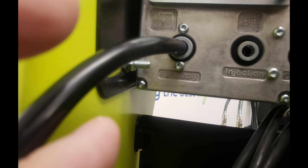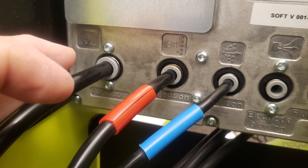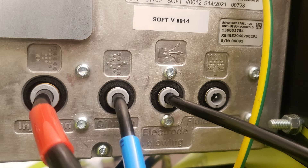The 10mm black air line which is supplied will come from the outlet port of the air filter and connect to the back of the InnoBox controller labeled air supply. Connect the black 8mm tubing marked in red to the push lock labeled injection. Then connect the black 6mm tubing marked in blue to the push lock marked dilution.